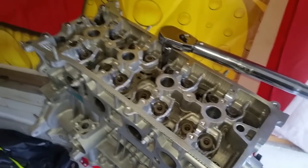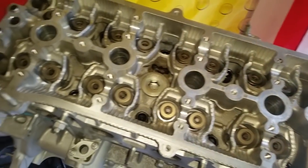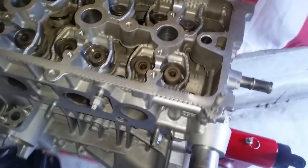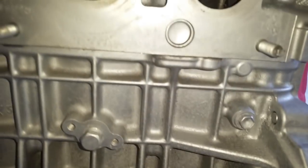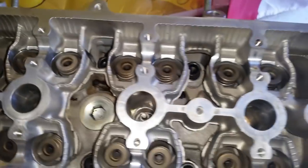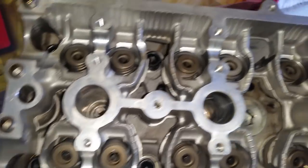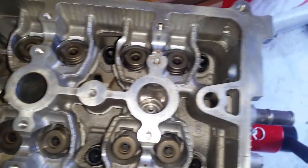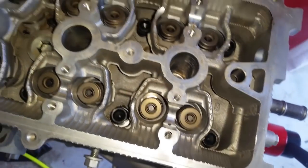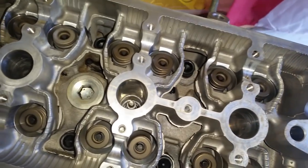And then after that, the 90 degree angle. It all has been torqued at 58 foot-pounds, but what I'm going to do is another pass of 58 foot-pounds. The reason is, the head gasket is a multi-layer steel and it just got compressed, so it might change the value on some of the bolts as they got torqued. So it is always a good measure to do another pass in the same sequence just to make sure that they are all seated still at 58 foot-pounds of torque, or 696 inch-pounds of torque.